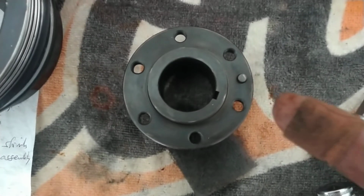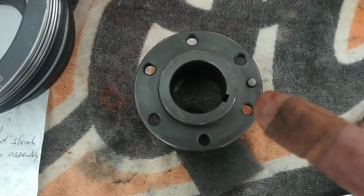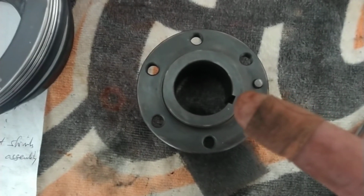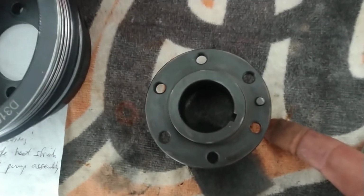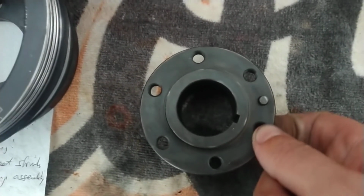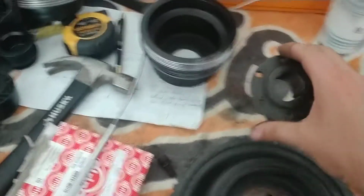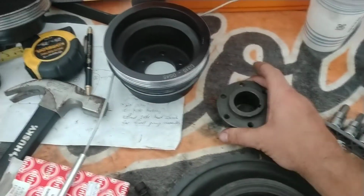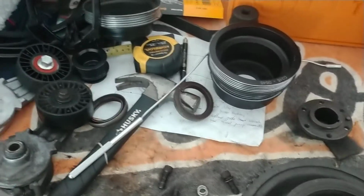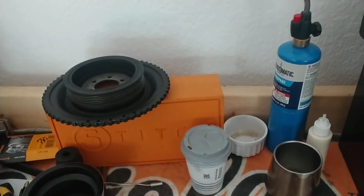And I've got to squeeze my head in between that transmission fan, whatever, cooler, whatever that is, and this hub, put my eyeball right on it and have that flathead behind there and just make sure I gingerly get that thing started. That's the way to do it, especially when it's been warped out a little bit. So yeah, got to get a new crankshaft seal. It's now going to be lucky number 3, and stay tuned. Supercharger to arrive soon.